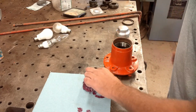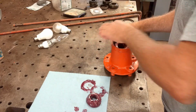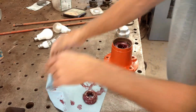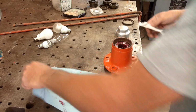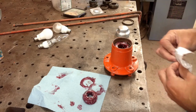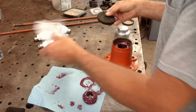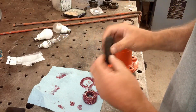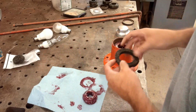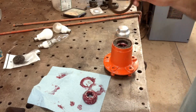Okay, I got these new bearings packed. Go ahead and drop that in there. Back side. The new seals, I really wouldn't even call them a seal, it's more of a dust and dirt shield. All they give you is this little felt ring. It's pre-cut. Just knock the centerpiece out. It sets in there and you reuse this old metal ring.